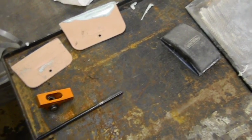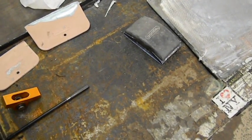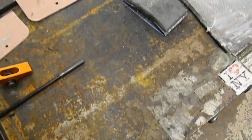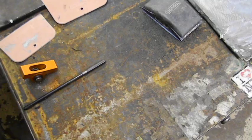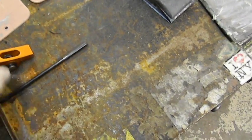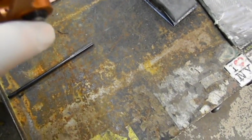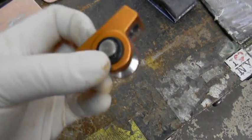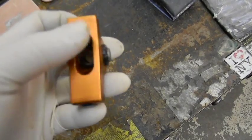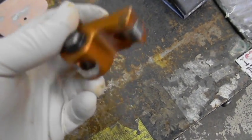Do not touch the cam bearings and do not touch the core plugs, which are freeze-out plugs. At this point, that's all I've got to say. Everything else is fair game. So it's all up to you, buddy. I'm just giving you a couple of helpful hints for longevity. You could put it together any old way, but we don't want to think about the rocker arms anymore. We don't want rocker arm issues.